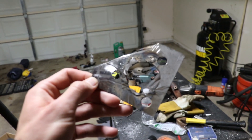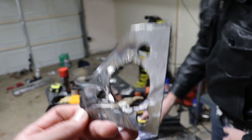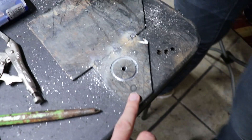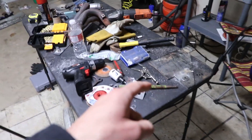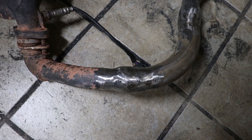Here's the deal — this is flange one. We tried to make it and it worked pretty good until Zach got to the part where we had to weld it, and then it became warped and bent really bad. So we had to step up the thickness. Zach literally went and cut part of his bumper for thicker steel. We're working on a new flange, but our $20 Harbor Freight drill isn't adequate to cut this hole. We need to get a better drill next episode. The turbo looks great mocked up there, and Zach welded and grinded the exhaust pipe and it doesn't look half bad. We just need to paint it, knock out the flange, and the hot side of the build will be done.